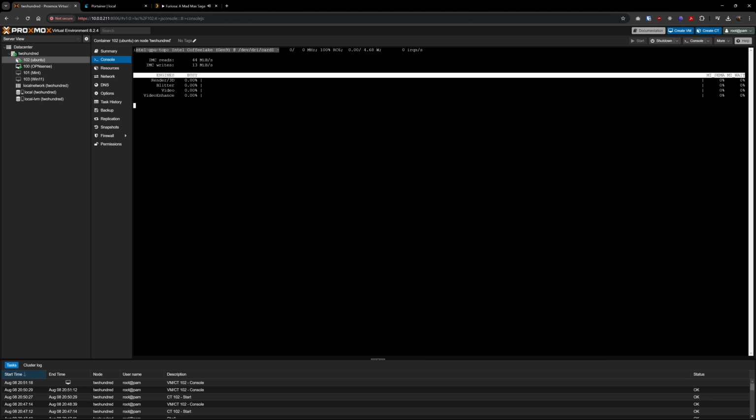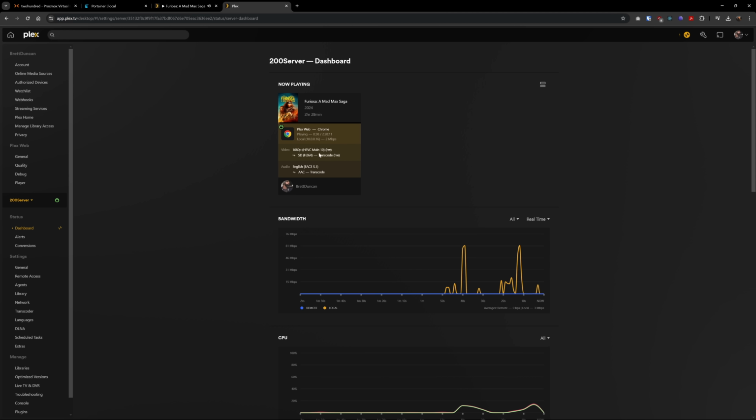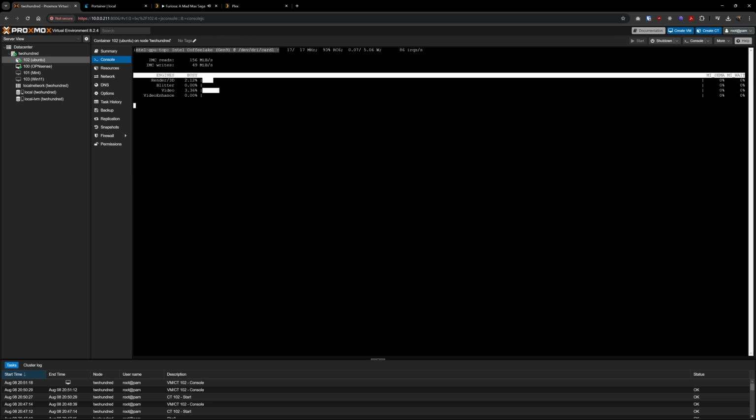After ensuring that our devices are properly passed through to our container, we can see that Plex is using our iGPU for real-time transcoding. Now, I'll be honest, the 8700 is plenty powerful enough to do software transcoding for a small Plex server, but this isn't just a Plex server. The idea is to see how much we can get out of a $200 server, and saving CPU resources by using an iGPU is one way we can do that.